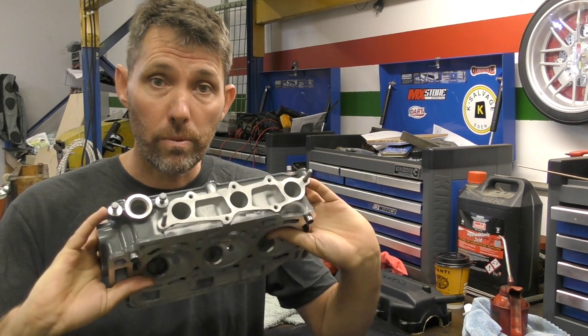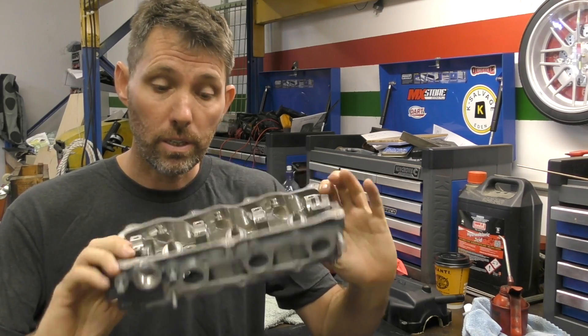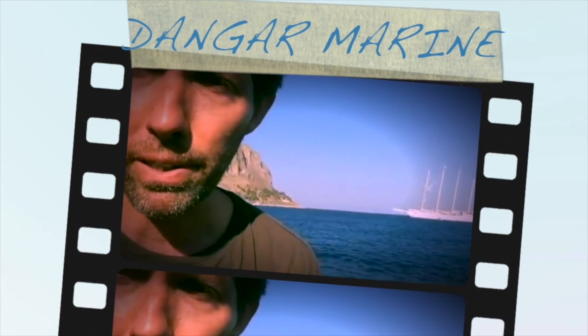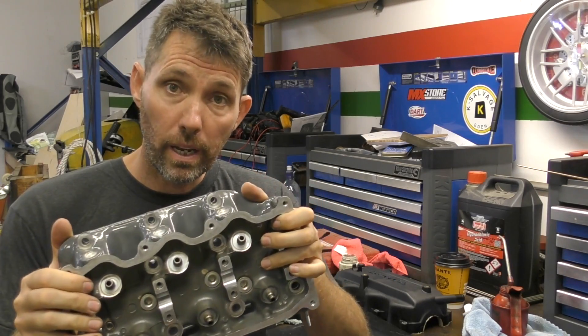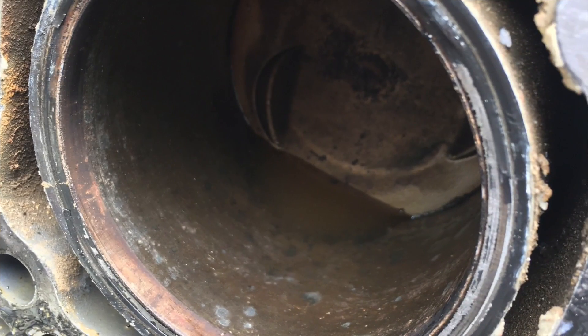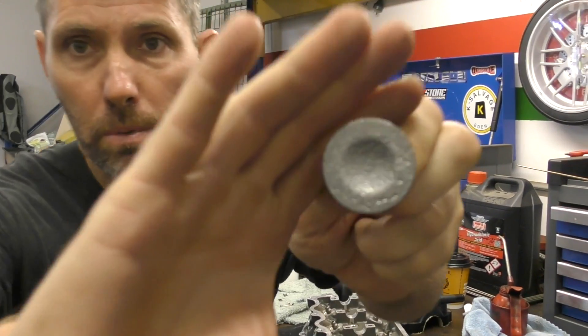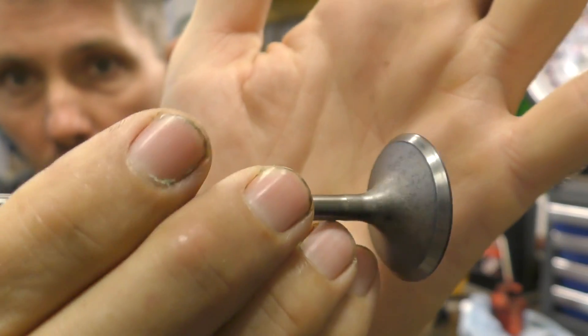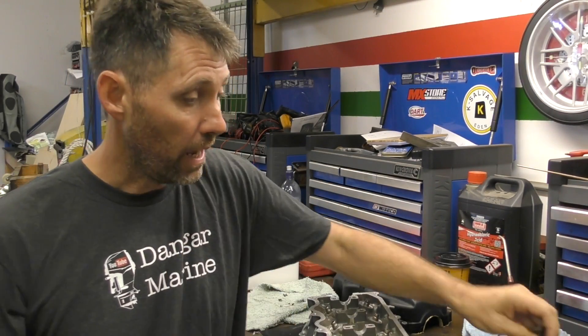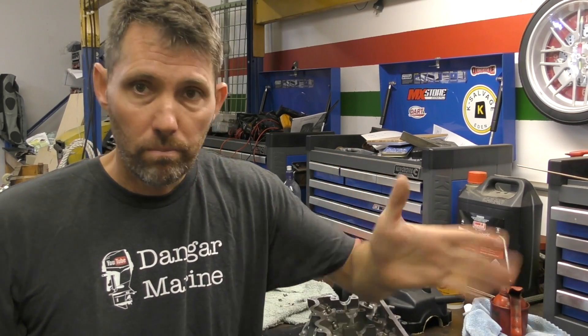Hey there, Dan Gastew here. Today's video is about reinstalling the valves and camshaft into this Honda outboard cylinder head, and is proudly sponsored by MarineEngine.com. This outboard had a blown cylinder head — there was quite a bit of water in the bottom cylinder and as a result the valves from the bottom cylinder look like this. The whole lot's been off to get machined, so the actual edges where the valve touches the cylinder head and where it seats are now fine, and the head itself has been machined as well, so time to put it back together.